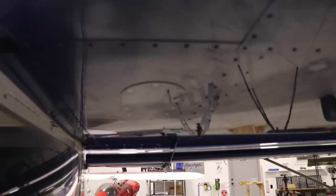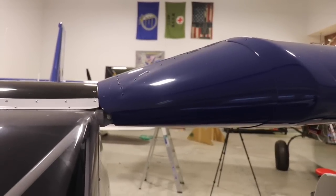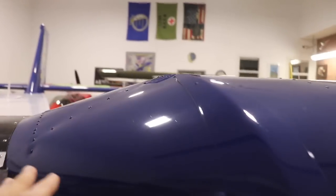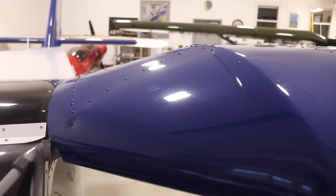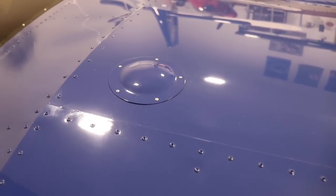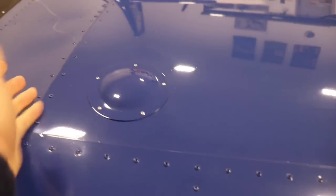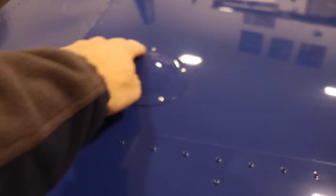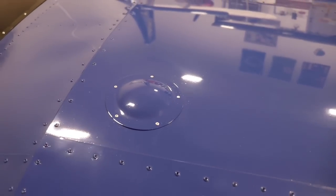You guess that it's the fuel sender leaking and you need to replace it. There is an access cover right here, but there's no way you're going to change a fuel sender through that. So if your sender is mounted on the side of your fuel tank, you will have to remove your wing from the airplane, drill out all of the rivets that hold the inner skin to the frame. Who wants to drill out rivets on a painted wing? But if you mount your sender on the top, all you have to do is drill out five little tiny rivets, take this cover off, cut away the Pro Seal, lift it straight out of the tank, put a new one on, and rivet the cover back in place.